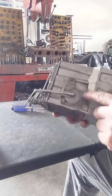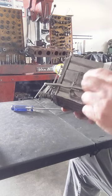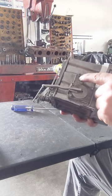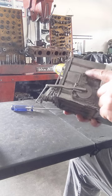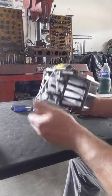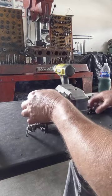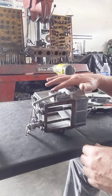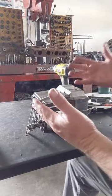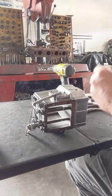There's six bolts, and these things get crazy sometimes, and these will strip out. And there's a spring, there's a diaphragm, of course. Then there's a little spring and a little ball up in this area right here. So I always lay it this way. Unfortunately, I have a vacuum deal on this, but I always like to lay it somewhat flat like this, so that ball doesn't try to go crazy in the spring and everything. It's just better to me, but you can go at it any way you really want to, whatever you're comfortable with.